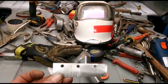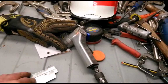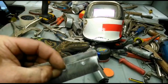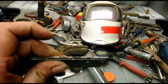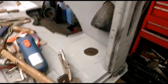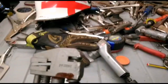which is prepped up ready with holes cut in it, ready for welding, when you fit them together, they actually are the same level, rather than if you didn't have the joggle, you'd have that double edge to try and get rid of. This is done with a little tool called a hole cutter and joggler, which you can actually buy yourselves. Basically, there you go.